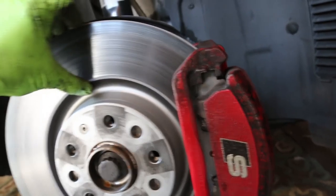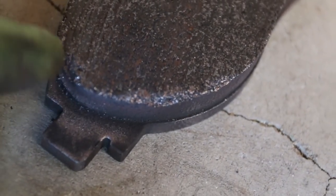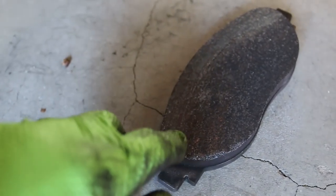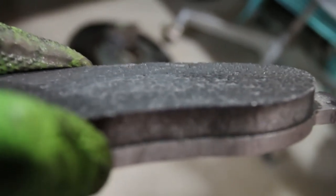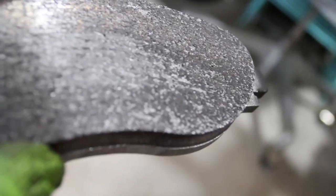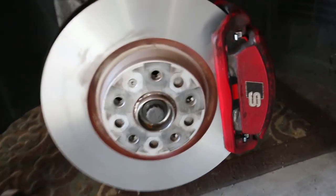On the outside front pad you can actually see it kind of got torn up right there, and on the inside right there too. The pads did good overall, but we had a little uneven wear. The other one seemed like it had a bit of a hot spot in the middle - you can see the center has a groovy, really abrasive spot. You can also see the difference in wear: the inside pad presses against the piston, whereas the outside has worn a lot more. That's after just one track day, which shows how much brakes can wear down - you really have to keep an eye on this stuff.